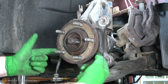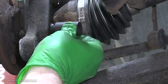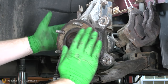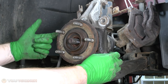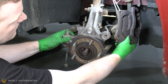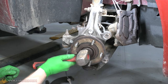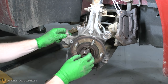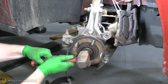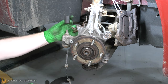Our next stage is to remove these four bolts holding on the wheel bearing. When you come around to the back you haven't got much access to get a socket on the rear. Yes, you can push the axle back to give a little bit of space but you might still struggle. One thing we can do to create more space is turn the steering wheel, which turns the whole assembly in one direction and gives us better access to two of the bolts. Once you've done those two, you reverse and bring it in the opposite direction for the other two. I put the old nut on and just hammered that back to get the axle in its most rearward position, and that will just about give you the access you need to get on your 15mm bit.